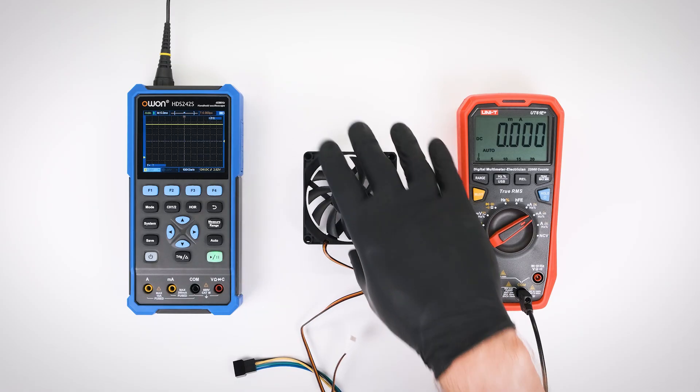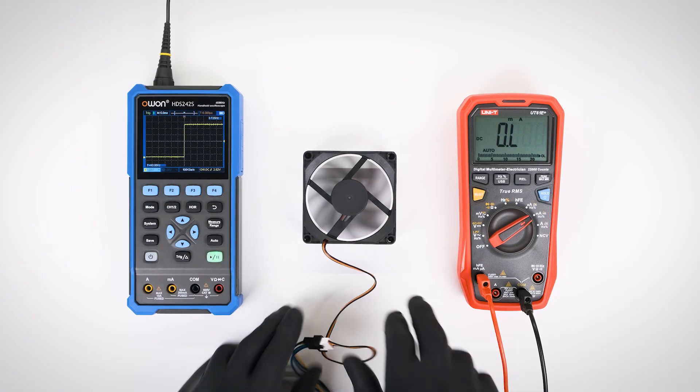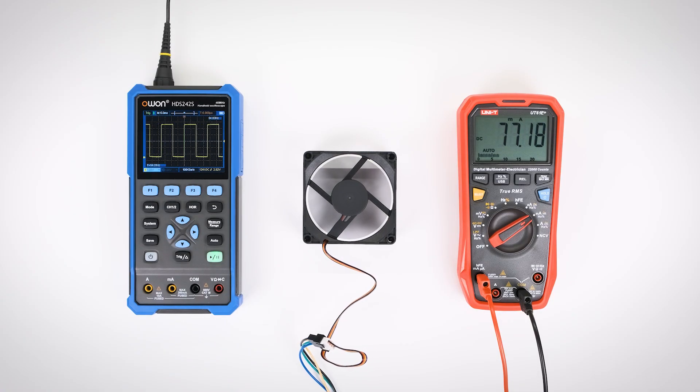I've taken all measurements with the fans running at full speed. This should give us a good idea of the fan's maximum performance and worst-case noise levels. In general, a higher RPM will produce more pressure and airspeed, but will draw more current and make more noise. Each fan will be optimised to run at a different speed, and having a higher or lower RPM isn't inherently better or worse. I'm using the fan's built-in tachometer to measure the RPM — most fans output 2 pulses per revolution, so the frequency is divided by 2, then multiplied by 60 to get revolutions per minute.